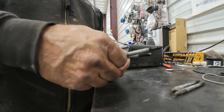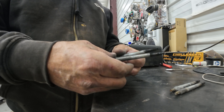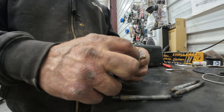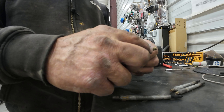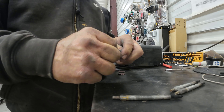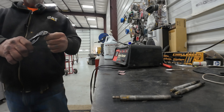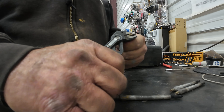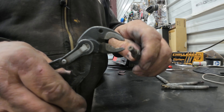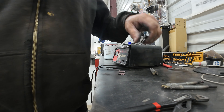This one's kind of weird on the end - probably should just get rid of that one. You see the gap? This is like an insulator and there's a hole in them that they punch. A lot of times if they're loose I'll take them off, clean that up, put them back on and try to stake them on good. That one's loose, this one's not loose but it's just corroded.